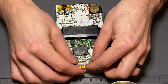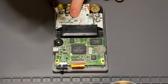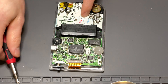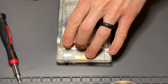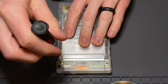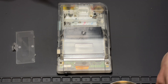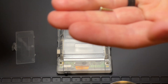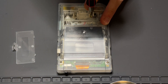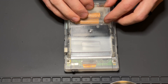Now you can tuck the wires in so as not to interfere with the back shell. Plug the display ribbon cable into the board, then press down the tabs on each side of the ribbon cable once installed. Install the two remaining screws through the board and fasten it down to the shell. We are now ready to put the back shell down and screw in the 6 tri-point screws. When using a new replacement shell, I find it best to use the screws included with the new shell, as the thread pitch is different — the new screw's thread pitch is wider, which allows it to tap into the plastic of the new shell. Once all 6 screws are installed, you are ready to put in some batteries, clip in the battery door, and insert a game cartridge to test the new screen.